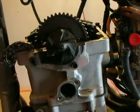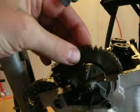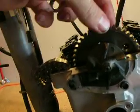Let's talk about what happens here. This camshaft is sitting up in here with this on it, and the chain running over. You end up snapping these bolts free — this one and that one. It takes a lot of force to snap them free. You think you're going to break something or wonder if they're reverse thread. You just have to crank on it. Make sure you have a fresh Allen key and use a lot of leverage. When it snaps it goes and you'll bloody your knuckles. That allows you to pull this off, and once you pull it off you can see it's free, and that little bit of play enables you to pull the cam chain off of the gear.